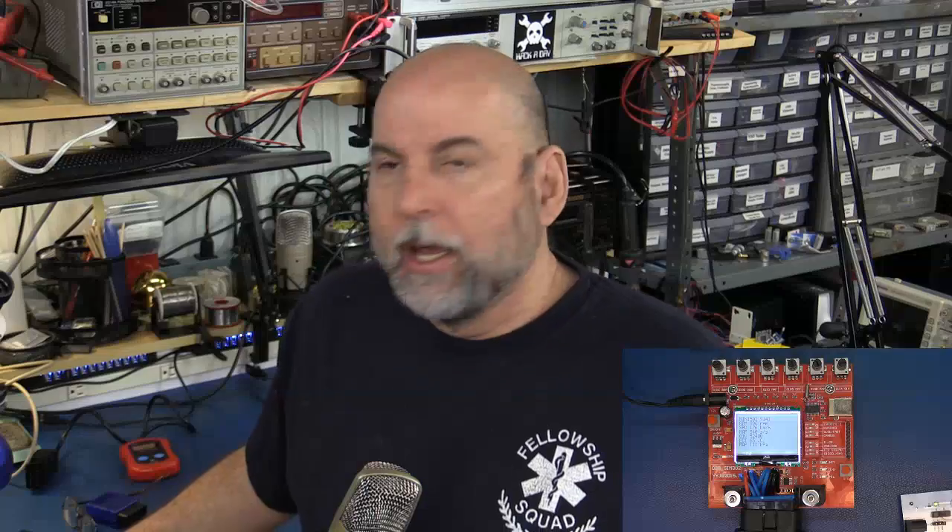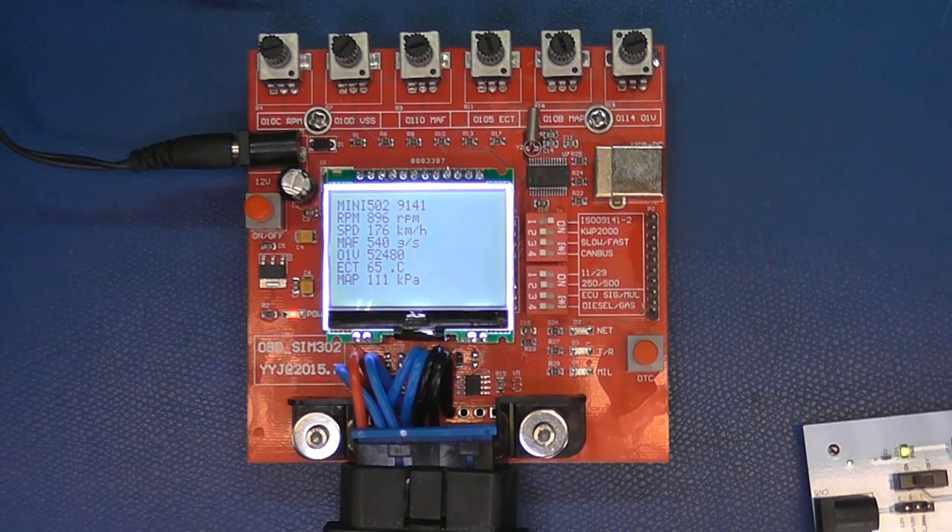I've been talking too much about hardware so let me show this working. OBD uses PIDs - parameter IDs - that you send to request information. An OBD bus doesn't just stream data; you ask for things and the ECU or transmission responds. There's also the DTC - diagnostic trouble code - which originates from the OBD bus. That's usually what your check engine light means: there's a DTC waiting to be read. But first I just want to get the speed of my car, which requires a car - and I'm not hooking strange hardware to my real car without testing it first.